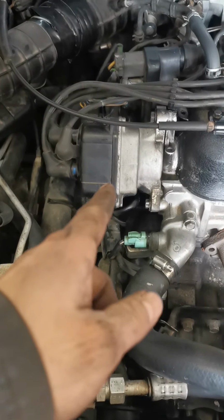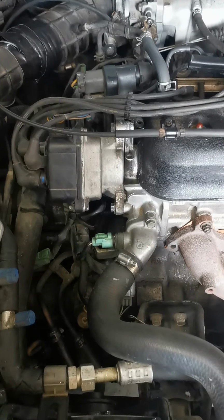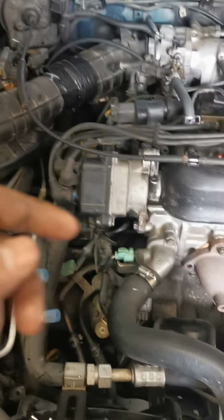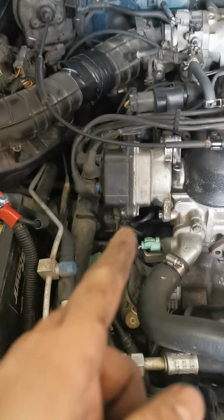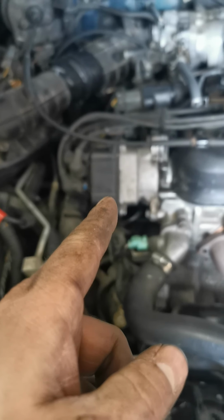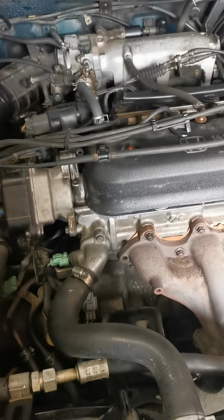Funny story, when I put that distributor in, I was having a lot of trouble the first time, and I really just gave her the what-if. And it turns out there's two little tangs that run the distributor into the cam sprocket. Well, a fella snapped one of those tangs right off. So I don't know how long that distributor is going to last. I will be hitting the wreckers here soon enough, or Rock Auto looking for a replacement. But it starts and drives.